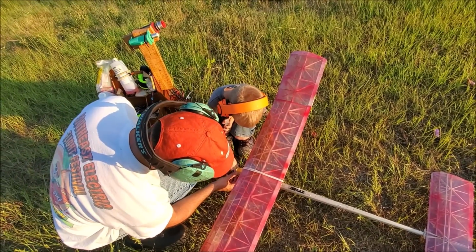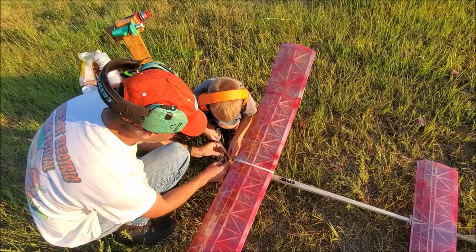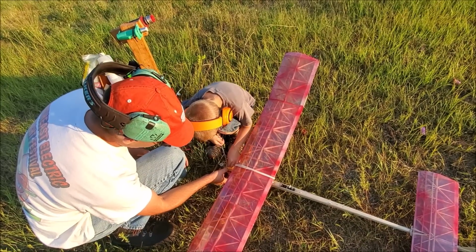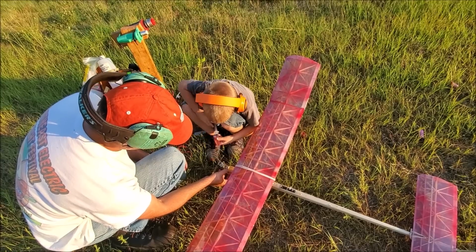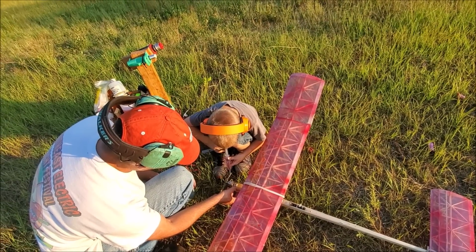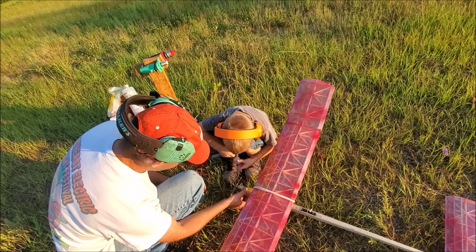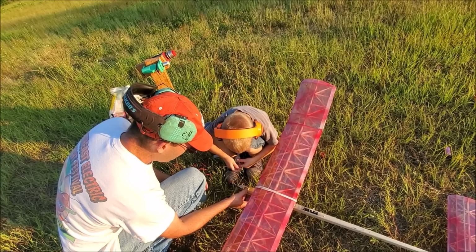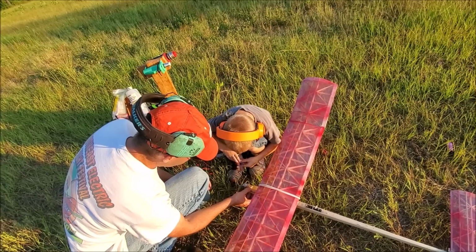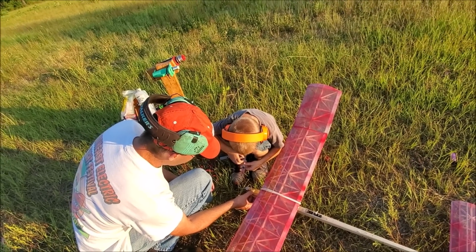Squeeze it all the way on there. Squeeze this end all the way on it. So kind of explain what he's doing. So he's just fueling the tank here. Now don't put all of that in there. Keep going. Now stop a second. Now we're going to prime the engine. So I'm going to stick my thumb over the vent. Now carefully squeeze a little bit more. Just do it very, very slowly. Stop. Yep. All right.